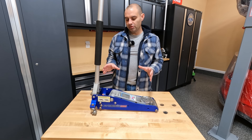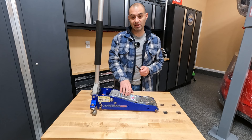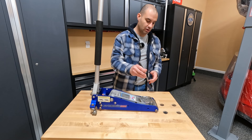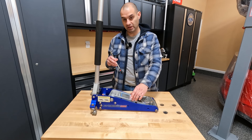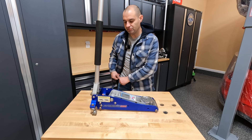Overall, this is a pretty good blend of aluminum and steel, which you typically see on inexpensive aluminum racing jacks as a cost-saving measure. The frame rails, lifting arm, housing assembly for the pump, handle, handle support, wheel supports, and side handle are all aluminum. There is some steel on this — the wheels, the pad, the side support arms underneath the main lifting arm, the lower arms, the top of the jack, and any hardware. So it's about a 50-50 blend of aluminum and steel to keep the cost down.